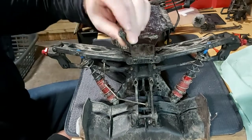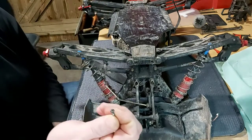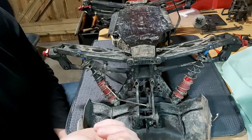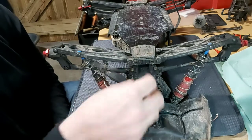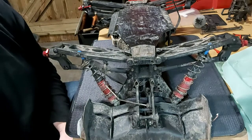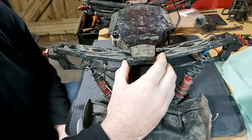So my advice is to take that off and get some shorter screws, which I've got here. I've got the button head ones. I'll put a link to them in the description as well. Shorter screws to go in and lock off the pin holder for the rear arms to stop that from being able to move anyway.